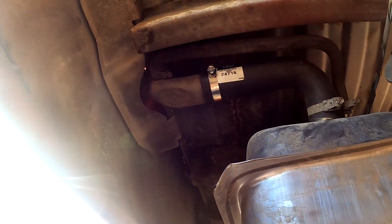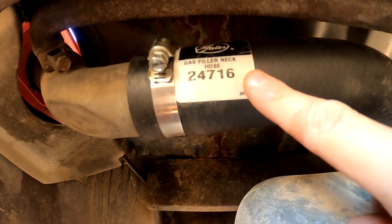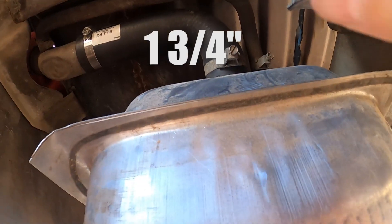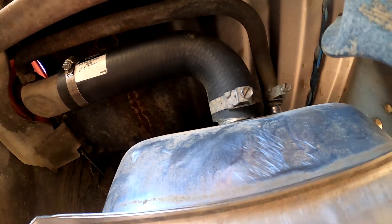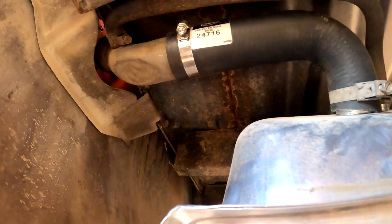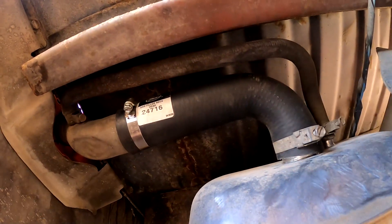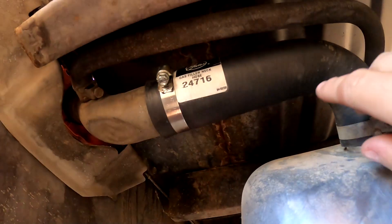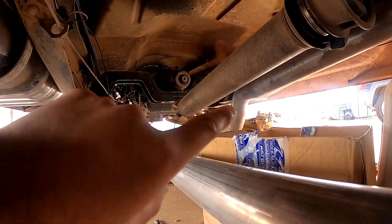Where we left off in the last video, my biggest issue was trying to find one of these filler neck hoses. I'll put a link in the description with the part number — I ordered it online through O'Reilly's. It's a 90-degree fitting, I think it's a one-and-a-quarter inch inlet and outlet, but it had about an extra six inches so I just snipped it off and it worked out pretty well. This vent hose here is the original stock one, which worked just fine with the original clamps.